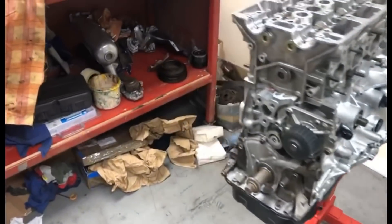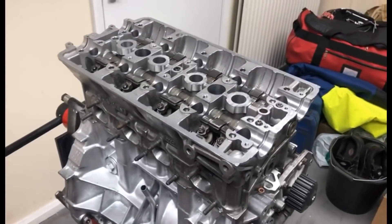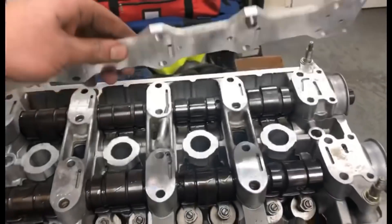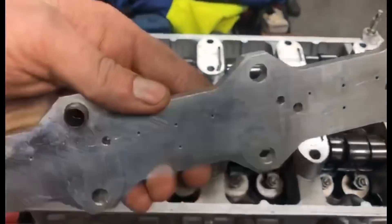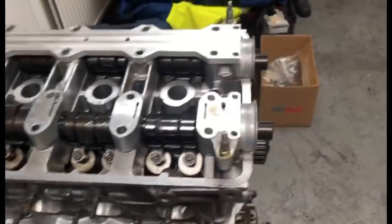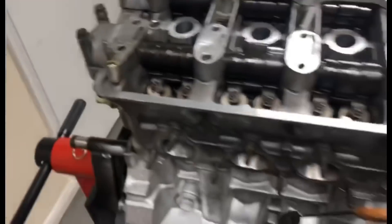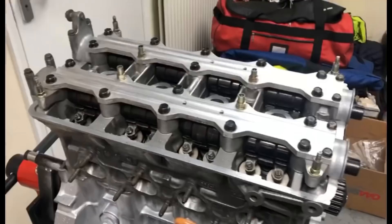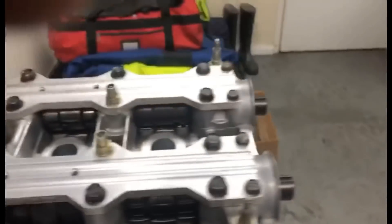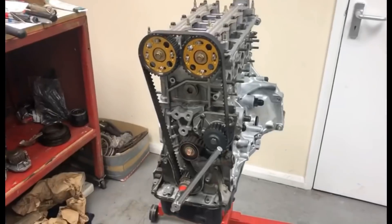It's on, just put a couple of other little bits on. D6 cams now being fitted - make sure you clean all your oil ways out otherwise your cams will go dry as they'll be blocked. Now gonna bolt all this down, fit the adjustable pulleys, fit the mounts, get the covers sprayed and so on. They're all bolted in, torqued down, so you can get the pulleys on, tension it up, get the belt on, and then just a few little bits after that.